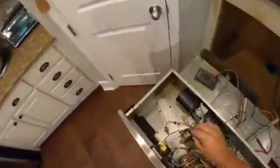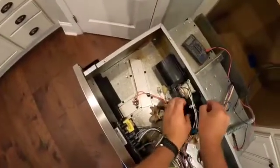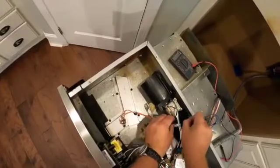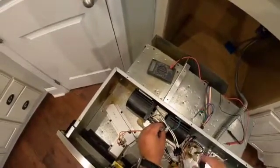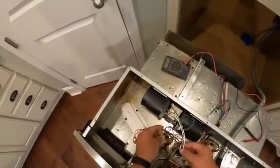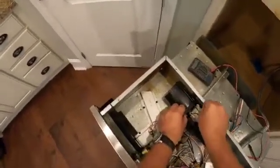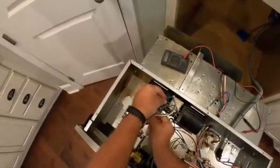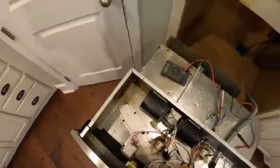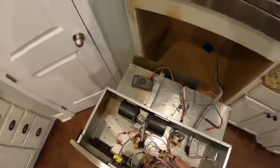before I proceed. We had a response, and so this ground wire goes in between the housing and the mounting screw, kind of like that. So that will ground the unit. I'll go ahead and plug these in. And we'll be in pretty good shape. We can put it on either upper screw we choose. So I'll probably use this one so we have room over here. So I will get that mounted up and we'll take it from there.